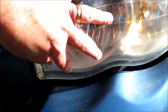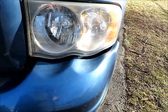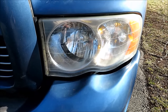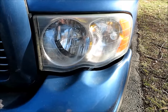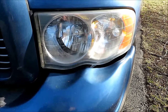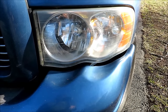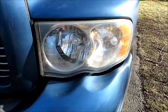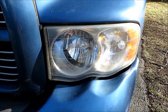Some people might say it's on the inside, but I can feel it — this isn't smooth, it's rough on the surface. Whatever's wrong with this lens I can feel it on the surface. I don't know if I need a more aggressive pad — like a microfiber or wool pad — or if these lenses are just so damaged there's no getting them back close to original. Ultimately I might have to actually do the whole sanding process with sandpaper and go through that entire method.